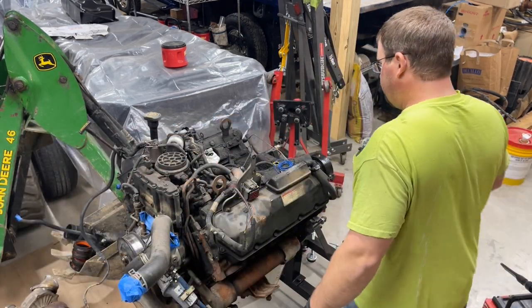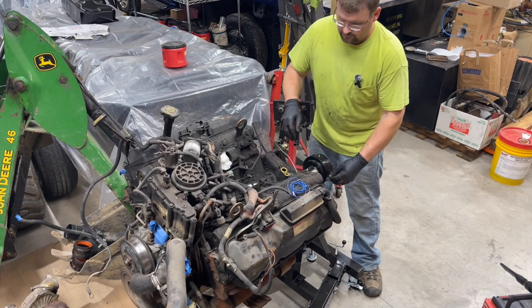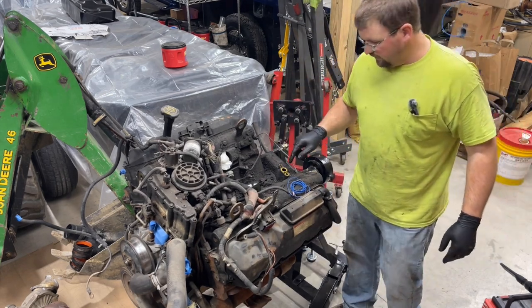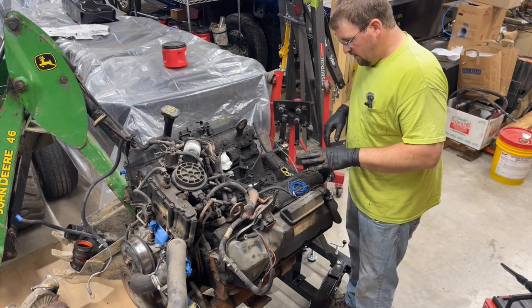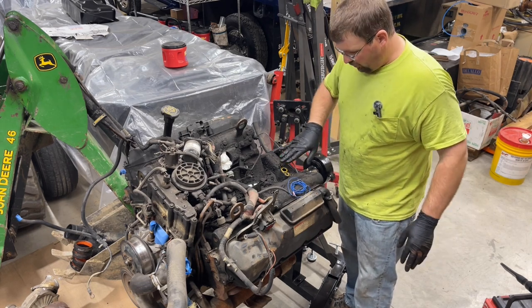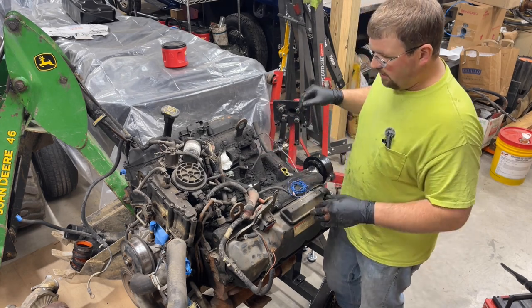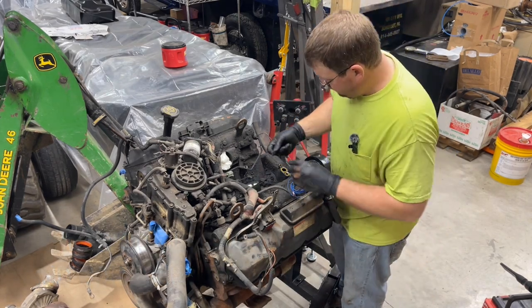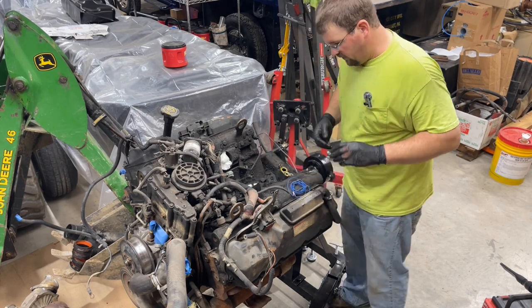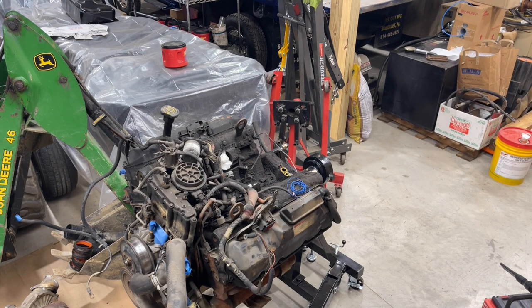We'll go ahead and turn this a little bit so you can see your oil feed and return. Now you can also see how grimy this all really is. So I may put a plate on here and cover these with some caps and take this out and actually hot pressure wash it, just to get all this garbage off of it. Because there are screws down in here, nuts down in there, everything else. But first thing we're going to do is get a paper towel and plug those holes, because you do not want to introduce any dirt into the oil system if you don't have to.